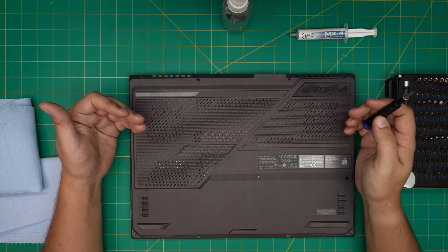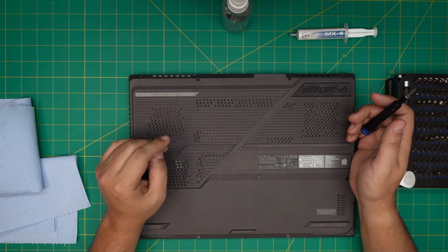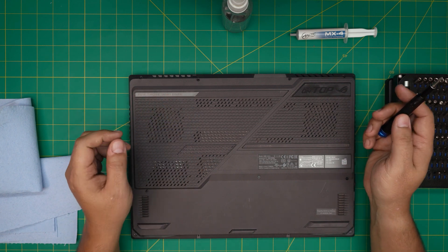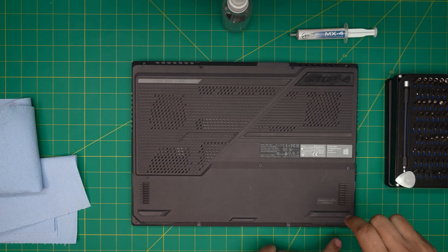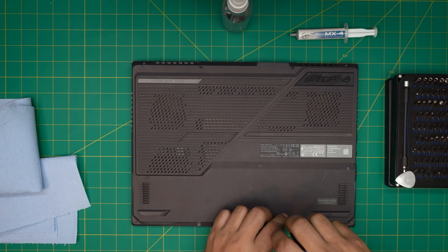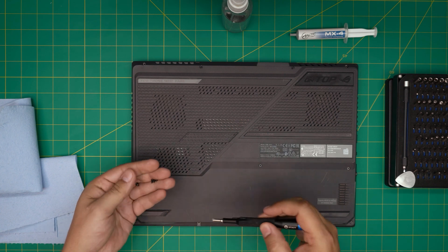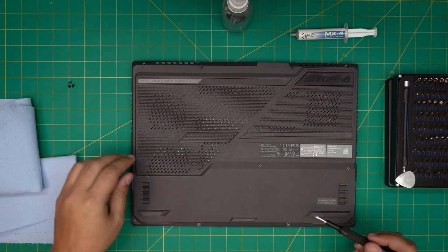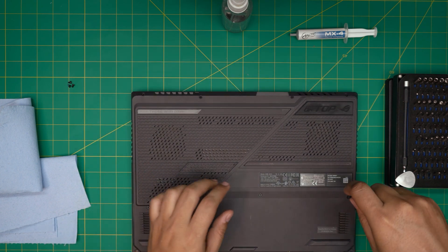With all that on hand, let's get started. Power it off and flip it upside down. There are a whole bunch of screws here — two types of screws and one screw with a C-lock that we cannot remove. First go with the short screws at the front end of the laptop. One screw on the right or left side is not removable — just twist it until you hear a click and let go. Remove the rest of the front row and keep them in one pile so you don't mix them up. There should be three. Then remove the mid row and back row and keep those in a different pile.